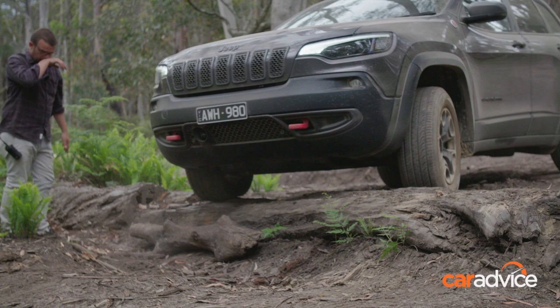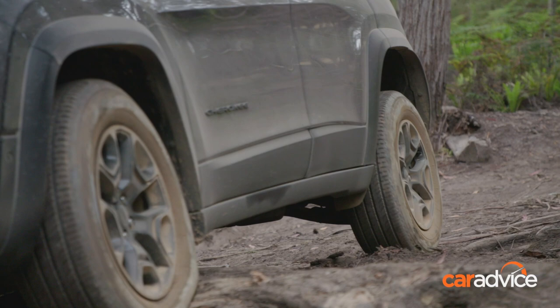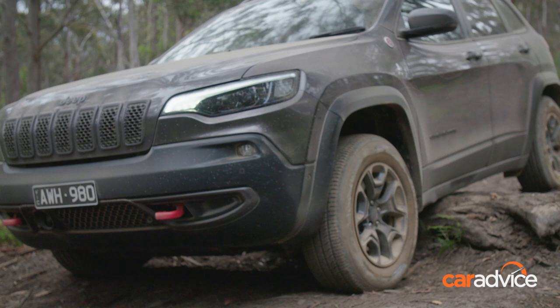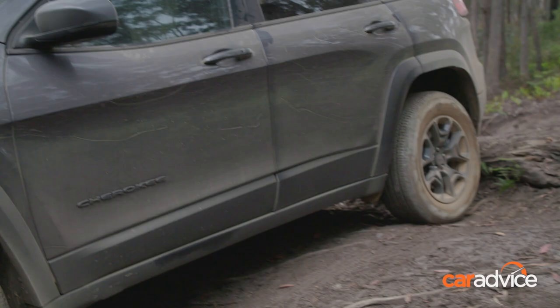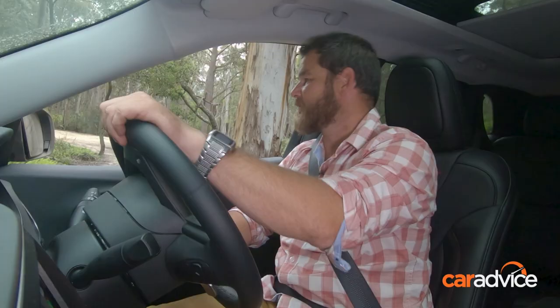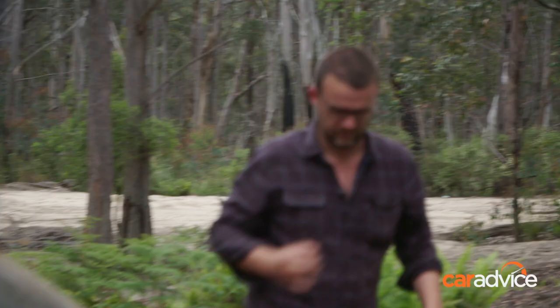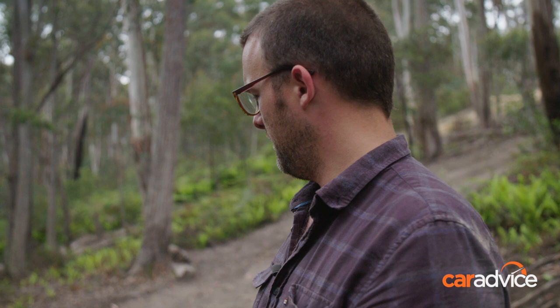Should be alright mate, slow and steady, it's close. Keep going that line. That time I controlled the car myself — I didn't use the hill descent because it was a bit of a tricky situation and I didn't want the car to run away from me. There are a mixture of ways you can use the onboard systems, and for the average person, the hill descent control is going to help them make it much easier to get down a slope. A little bit of track building helped make it a bit easier. You can do stuff like that in these less capable cars, but you've just got to be a bit smart about it and be really picky with your line. Have someone spot you if you're a bit unsure.